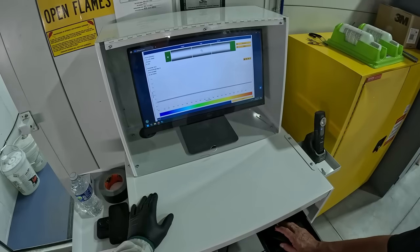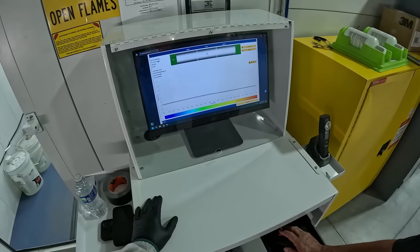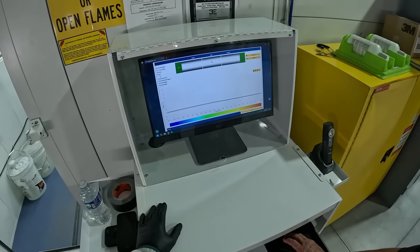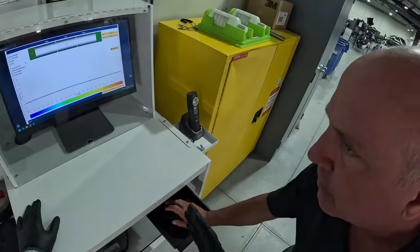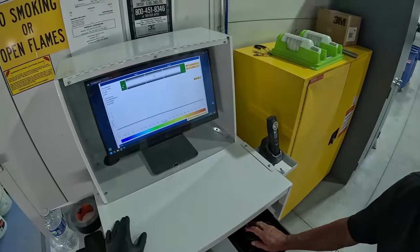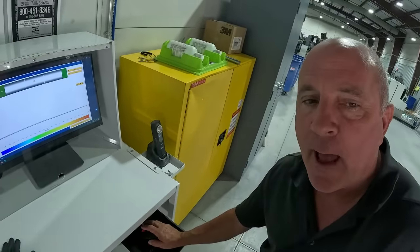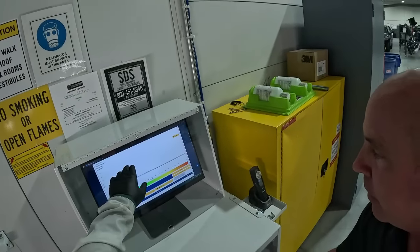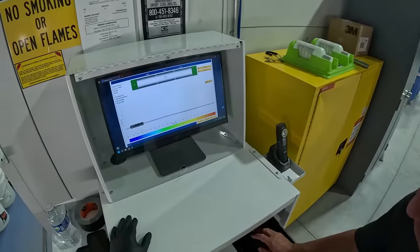So this will be a real color. It's a Volkswagen color, LA7W. And then it picked a redder variant. What's the match number on that? Does it give you a match number or no? Is there a scale where they know that it's a good color? Right here, it's 94%. When it's green, it's a blendable match. Anything over 80% will be green. So would you go with the adjusted or with the match? I would go with the match. It depends on the spectral curve down here.